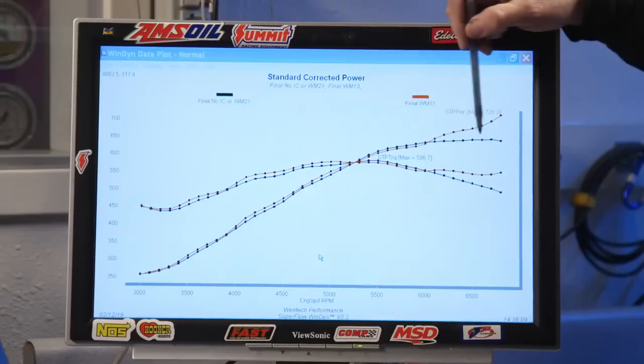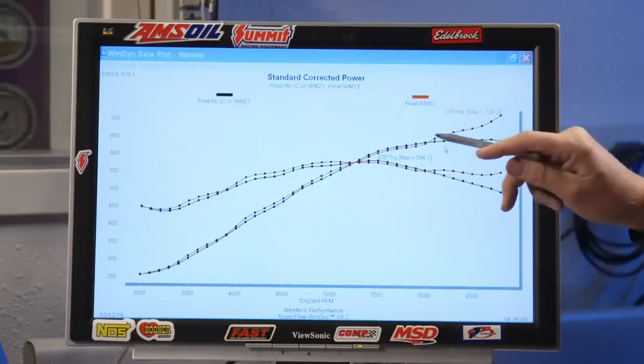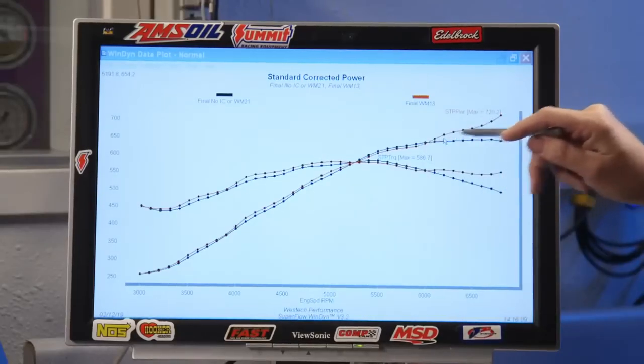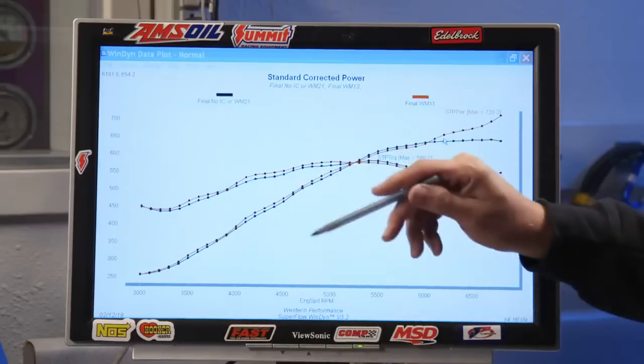So what we're looking at here is black is no charge cooling whatsoever. It's what we just did. No methanol injection, no intercooler. And red is with water meth injection. So there's a big spike in power towards the end, and that's got to be boost related if we look at the boost curve. Yeah. But what's freaking me out is that all throughout the power curve, it's not that different. No, how similar. And actually, the water meth is up just a little bit from the no water meth. A little bit better, but not as much better as I expected with those charge temps.